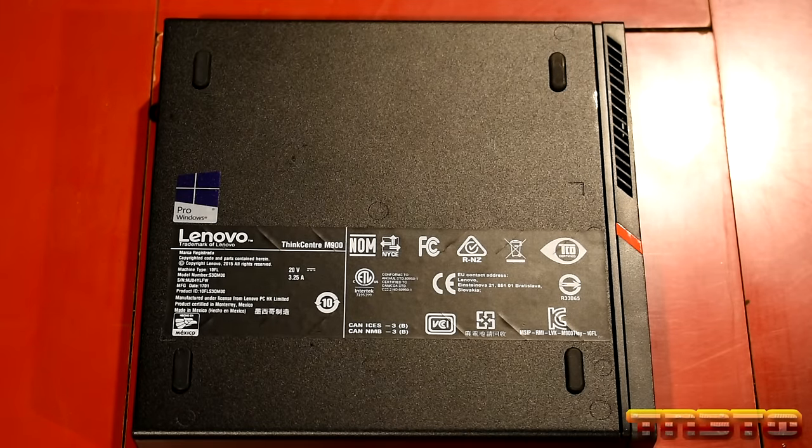There we go. And now it creates the proper system partitions and everything. You always want to click on that new to do that. So now we have our main partition 3 here, 1 terabyte, we'll click next. And now it's going to install Windows 10 onto our 970 Pro SSD. And the hard drive activity light is blinking rapidly on the system right now.